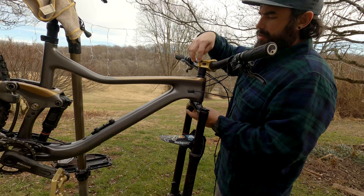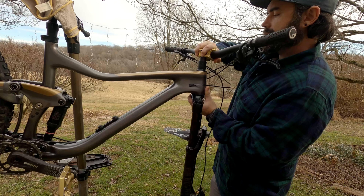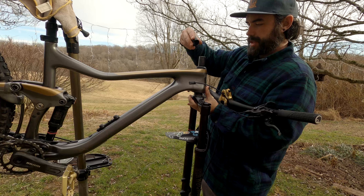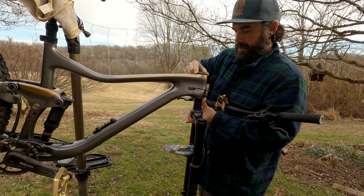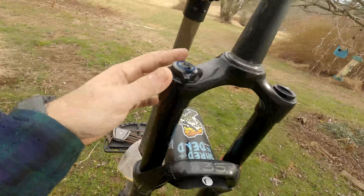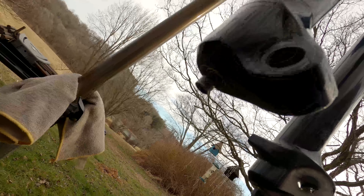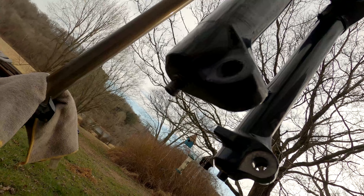With our bolt out and the rest of the stem loose, give it a little wiggle to get it off. All right, there goes that — this is when everything starts to come apart on you. Put all your spacers aside and the fork slides right out. Now we have the fork out of the bike. We're going to make sure our compression is all the way open and our rebound knob is pulled out. Mine's been missing for two years — you cannot get parts for this fork at all. Seems like they just want you to buy a different fork.